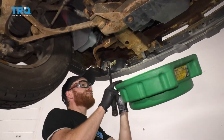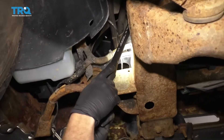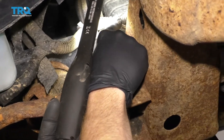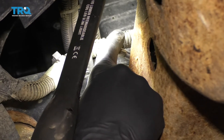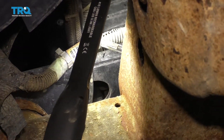You want to have a nice collection bucket, something that's going to be able to collect and recycle that coolant when we're done. We'll put them over here. If you look right up along the side of the radiator on the bottom left-hand corner, you're going to see right on the corner there should be a little petcock. It's like a little twisty knob — you would turn that to the left, and coolant will come out. It might make a mess, so be very careful.